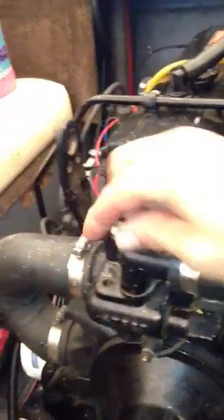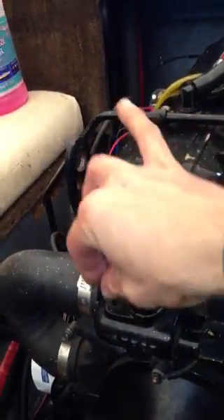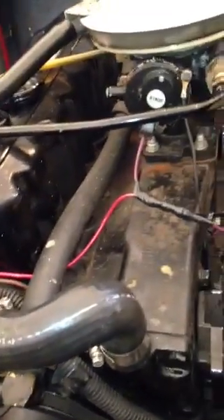So you've got your thermostat in here. I'd take this plug out of this hole to relieve the vacuum on this line. I usually pull this hose off and pour antifreeze into there.